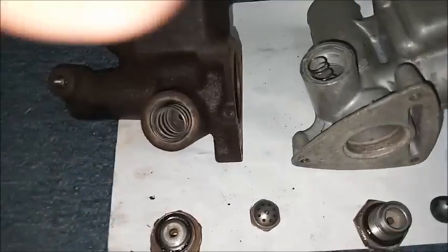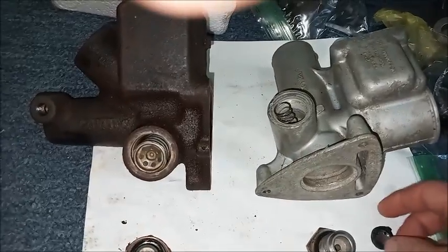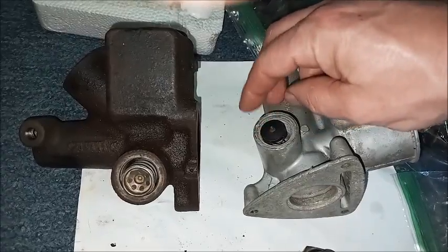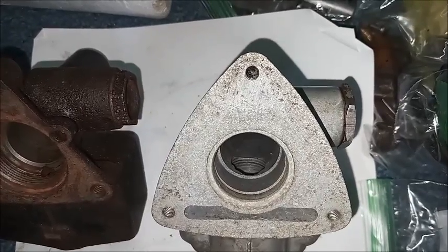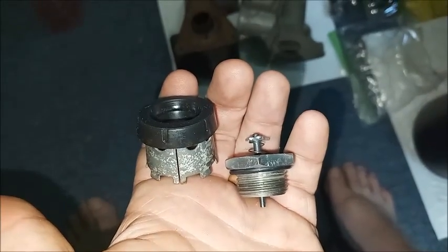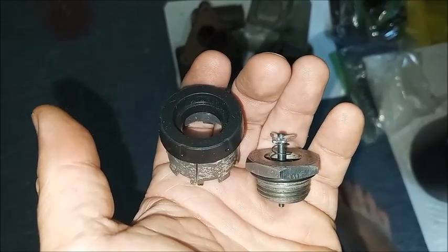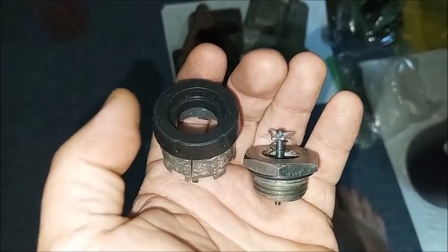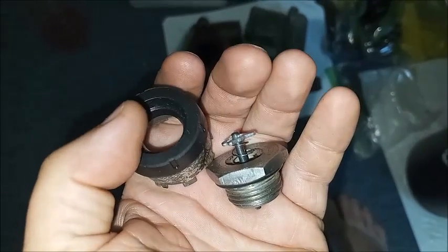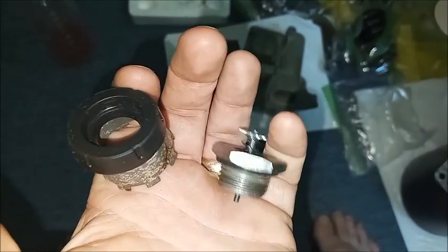The springs go in first, followed by the residual valves. They both take a 1 1/4 inch socket to tighten. Next up is the sealing mechanism for preventing fluid from traveling between the master cylinder and the reservoir when brakes are being applied. On the Delco Moraine, it's this primary cup retainer and primary cup, primary seal. And on the Bendix, we have the compensating valve.